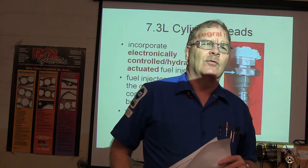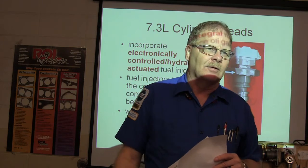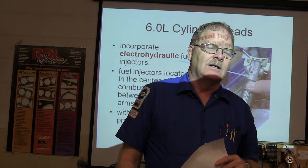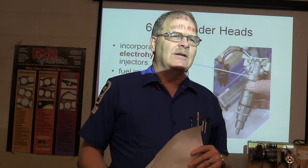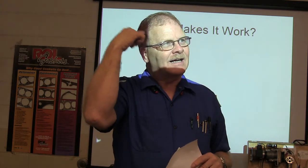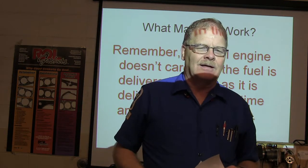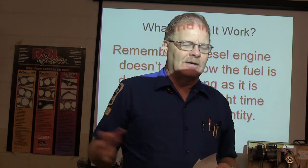I hadn't heard of that before. But anyway, he says there's a little spring there, and you just move that spring and it holds the cable off the tire, and it takes care of the problem. The following week, one of the shop foremen had a Jeep that was making a noise whenever it was loaded. A bunch of us got in the Jeep, a bunch in the back and a couple in the front. We were driving along, and he was hearing it go click, click, click. I said, I heard that guy talking about that. And I told Johnny, the shop foreman, stop the Jeep right now. So he pulled over, and I got out and laid under there and moved that spring. And he drove it, and all the noise was gone.